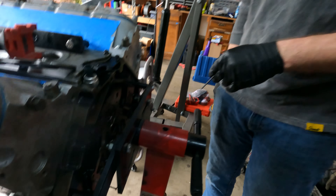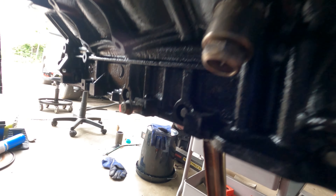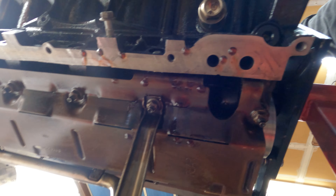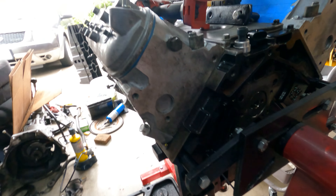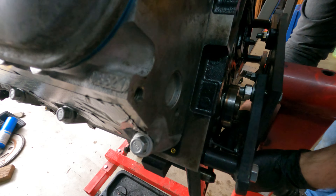We kind of jumped the gun on getting the barbell out. This oiling barbell basically separates the dirty engine oil from the clean engine oil — you can see those two holes there. What you do is just get a wood screw, drill it in, and then take pliers. That thing's only about a half inch in there but it's really in there, and then you move it ever so slightly to work it out.